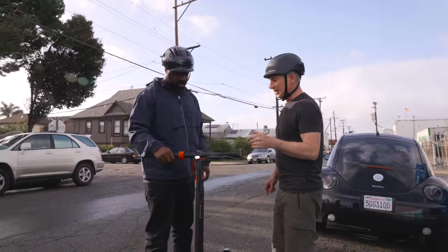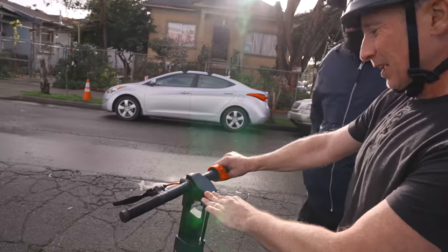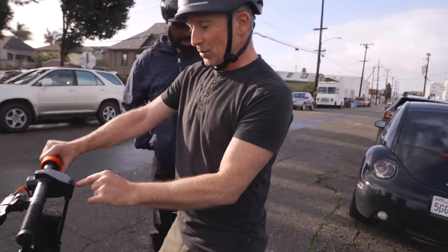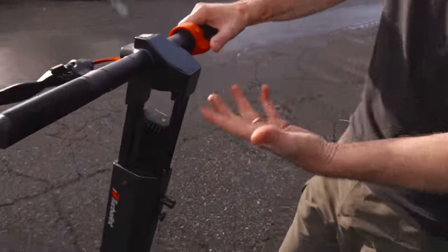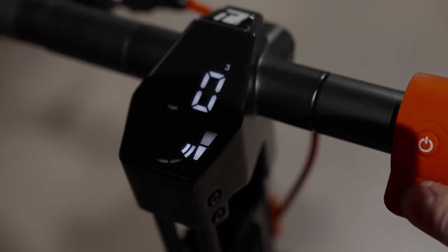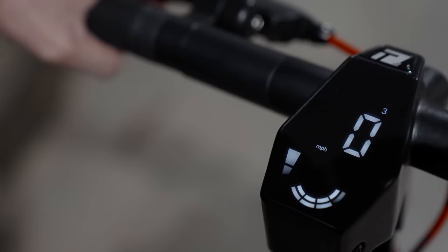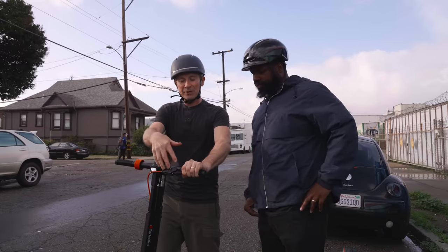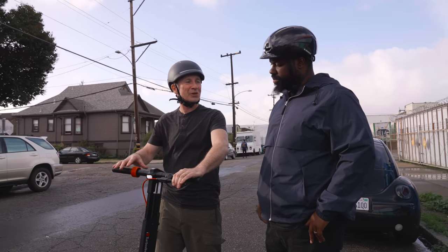Something else I noticed about the dash when I was riding it — two things. One is it's not the easiest to see; I wish it were a little brighter. We're out in the sunlight and it's readable, but you really have to look at it. The other thing is you can see the throttle on the display — it shows you how much throttle you're giving it with one through four bars. This is a kick-to-start scooter so it's not going to take off, but you can see the throttle bars. And on the other side, it shows how much brake you're applying — one through four bars. If you really yank it, you get all four bars on the left side. That tells me there's a sensor that knows how hard you're pulling and gives you a different amount of regen depending on how hard you pull the lever. That's a newer thing we're starting to see on some scooters.